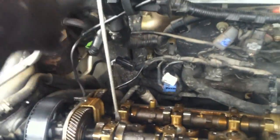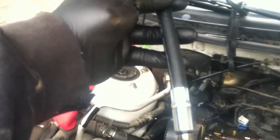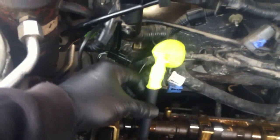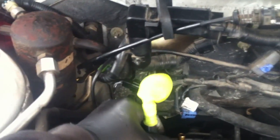Let's start over. This time we're going to use a balloon. Take the screwdriver out. You want to get some kind of hose — it can be anything — as long as it can screw inside the spark plug hole with the open end. Put it down in like that — remember, this is number one cylinder — and screw it in. Then get a balloon and slide it on top. Tighten up the hose after putting some oil on the tip of the threads that screw into the spark plug hole. Get it nice and snug; it doesn't have to be tight.